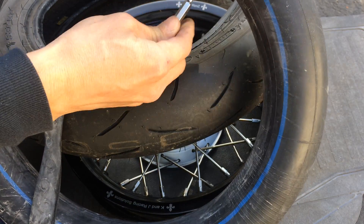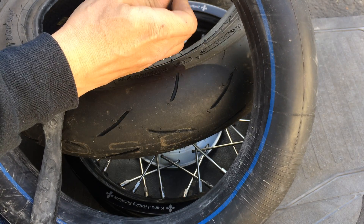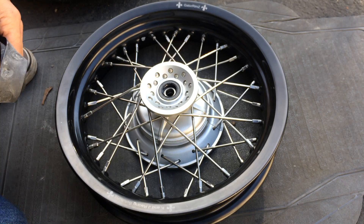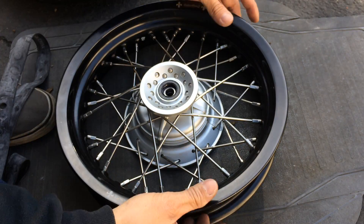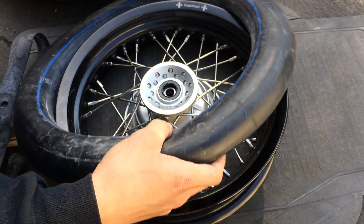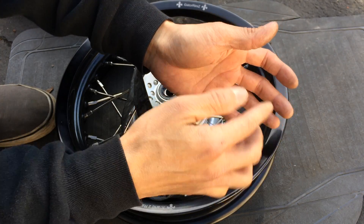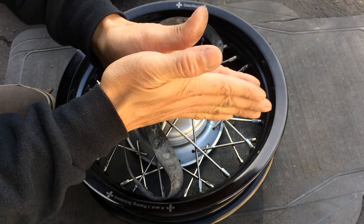Let me deflate this real quick — I have a valve stem here. So I need to put on the rim strip, and whenever you replace the tire, even though the tube might still be good, you should replace the tube and put in a new rim strip too. Inside the tire there's friction as it rolls — friction between the tire and tube that actually wears down the tube.